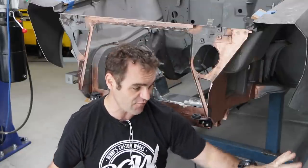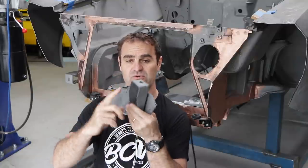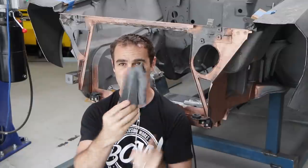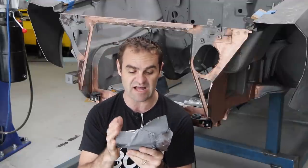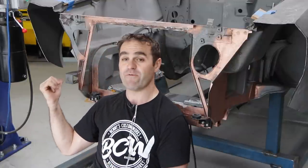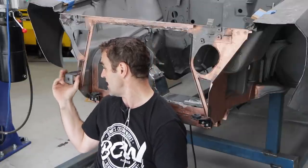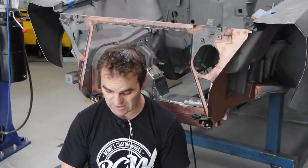Before I can actually mount the front nose cone on properly, one of the last things I need to do - and it will also help with lining the nose cone up - is mounting up the other bumper mount bracket. I've got the old bracket that's been welded onto this mangled piece of botched metal, but the bumper bracket itself is a quite robust, solid piece, so I can cut this out and reuse it. I'm going to go off of the one I've got on the driver side already - that's already in the right spot - so I'm going to measure from that to work out where this one needs to go, then get it all lined up and get the bumper and nose cone in the exact right spot. Let's start trimming this up, measuring and mounting.